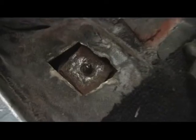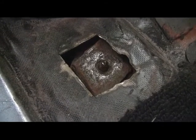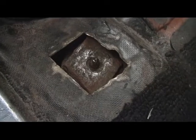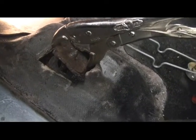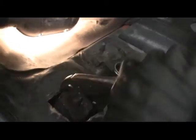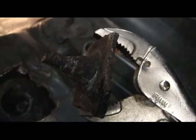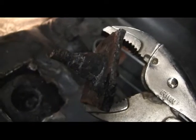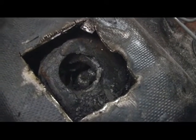I tried to clean it up pretty good around that body mount bolt. I'm going to put some heat to that to try to loosen it up, and then put an impact wrench on it and see if it'll come out. I put the vice grips on it to hold that like a big nut and went to turn the bolt on the bottom — and this is what happened. Basically snapped the bolt right off, which doesn't surprise me. This is almost like a big speed nut. There was no way that thing was coming out of there no matter how much heat I put into it. One body mount off, and I've got some sheet metal repair to do.